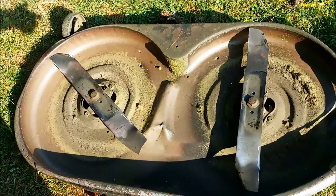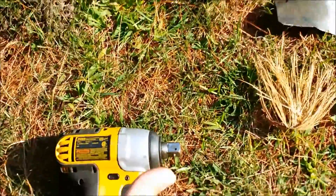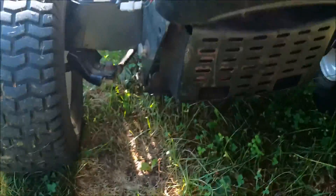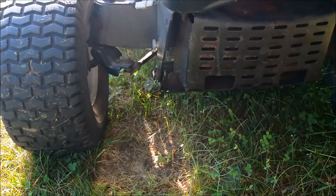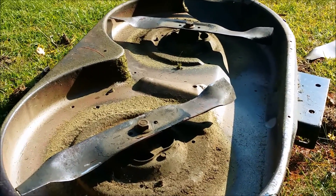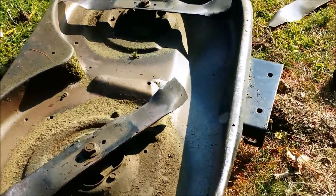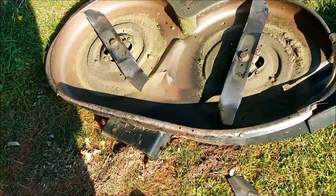Now the deck happens to be off the mower here, which only takes a few minutes. But with the short head on this thing, all I have to do is actually jack up the mower from the front, get the mower under there, jack it up, and once you've got that you can zip the blades off in about five minutes — a whole job front to back. Fresh blades. When you have sharp blades it's a whole lot easier to cut. Less energy on the motor, more productivity, all that fun stuff.